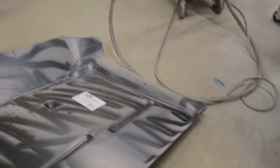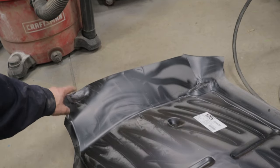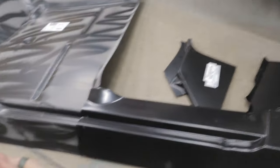I'm trying to figure out where I want to terminate the floor. I don't want to get up into the center hump area, so we'll probably be cutting part of that off. And I definitely don't want to go way up into the firewall — there's insulation against the firewall that I really don't want to pull out and risk catching on fire. So we're going to stay low. The rust isn't that bad up there — it's really bad in the outside section and the bottom part of the floor. That piece was maybe 20 bucks so it's just worth it to wait for it to come in the mail rather than fabricating it.